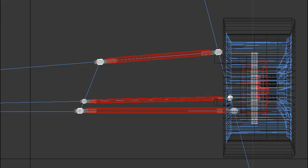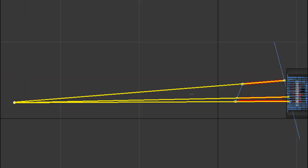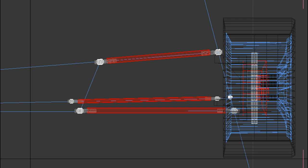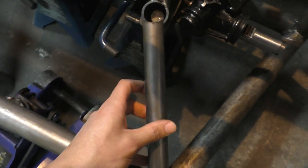I explain bump steer more in the suspension geometry Part 2 video. Quickly: if you draw lines passing through all your control arms, those lines should go back and intersect at the same point. The lines passing through all the ball joints on your control arms should pass through the tie rod ends too. If you follow these lengths and angles, even if you offset the tie rod end for Ackerman steering geometry, it still shouldn't cause any bump steer. Now I just have to cut and notch a few tubes and weld them to the steering rack bracket to hold it in position.